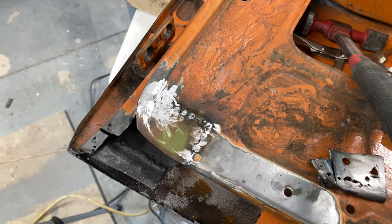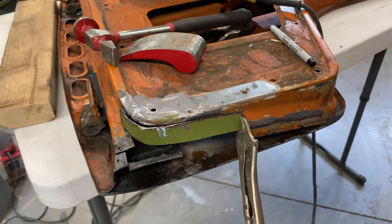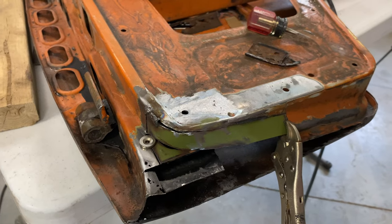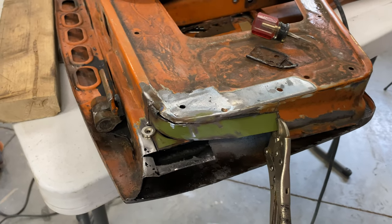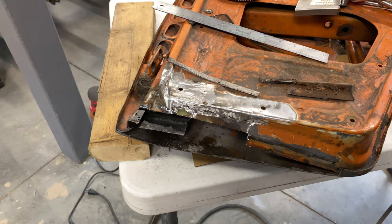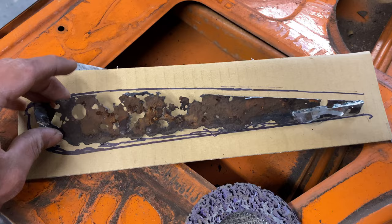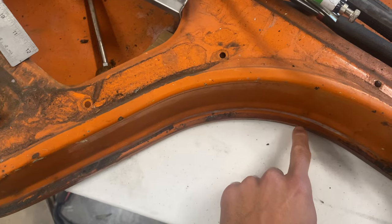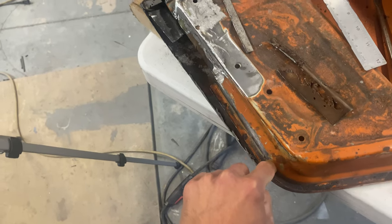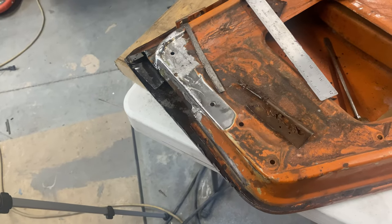As you can see, I'm doing this little by little — I'm bending, I'm folding. It's just a big, long process of getting this done. Thankfully, this is not really going to be visible; it's going to be behind the door panel, the door card. The main thing I'm focused on getting correct is basically the bottom of the door so that the outer skin will line up well and look good, and then the inner part where the seal runs along, because I want it to seal correctly. Other than that, I just want the general curvature to look correct and for things to fit.